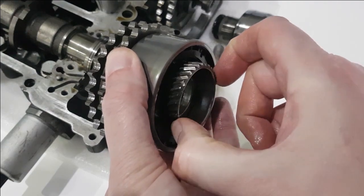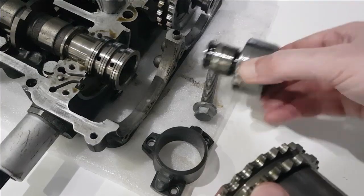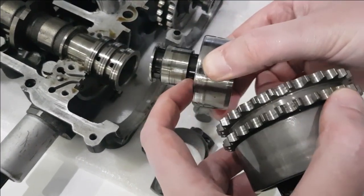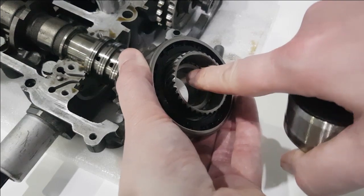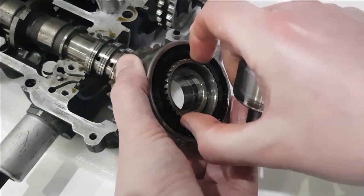What that does is it serves to push this spiral in this way — so that's pushing the timing that way. And the oil which goes through this other hole passes through the slots in here, then goes through into these holes in this section and basically to the back of the spiral.